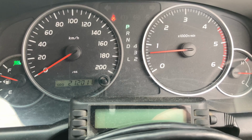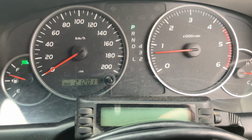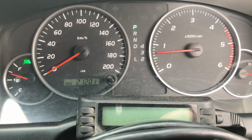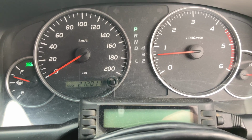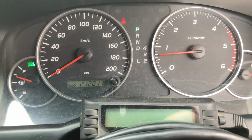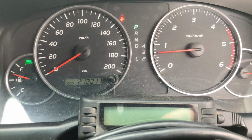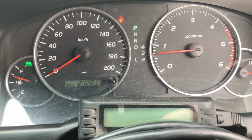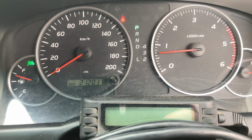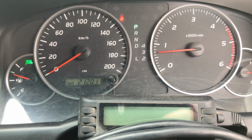Okay, so I think we've nailed it, right? We've got to have a look at the tyres, but we believe the wheel bearings are noisy, even if they're not. Because of the kilometres, we're going to recommend them. Okay, the engine mounts. Now, the engine mounts, it's more in the 07, 08, some 09, 120 Prados, not 150s. They're problematic, they vibrate, they're not going to break. It's not imperative, the engine's not going to fall out. It's just that annoying vibration, mainly when it's cold. And this is warmed up and gone away now, right? So I can't demonstrate it for you, but I've demonstrated it before. Just search on our channel, engine mounts, and I bet you'll find something.